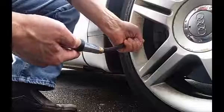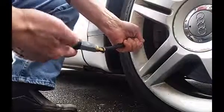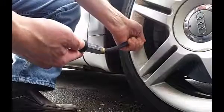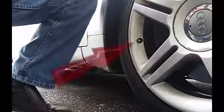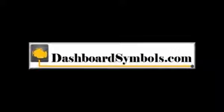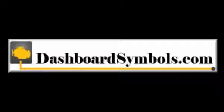Continue until the pressure matches what was found on the door post label. Note that if you are using a pump with a preset pressure, air flow will begin when the hose is pressed to the tire valve. Repeat this process for all the tires found to be below the optimum pressure, and you'll be set to go. For more useful videos and information on automotive warning lights and push button start cars, check our channel here on YouTube or go to DashboardSymbols.com.